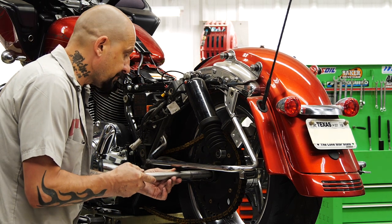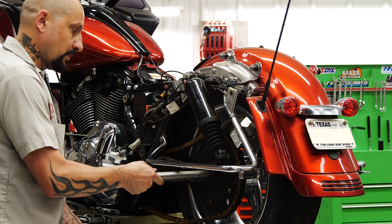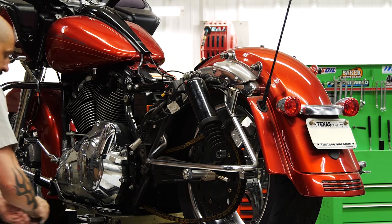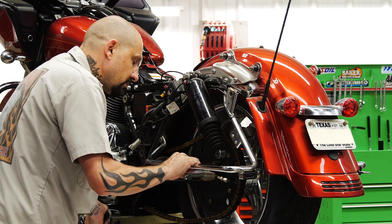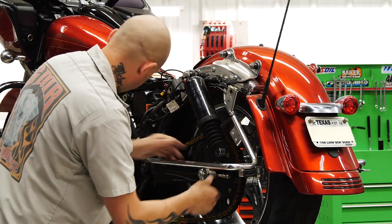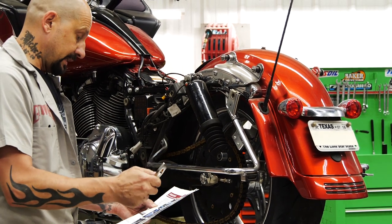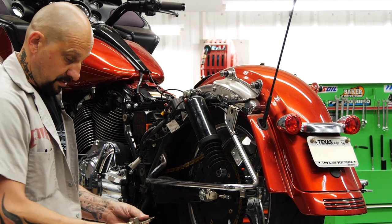Slide this in. At this point the adjuster wanted to hit, so hold it into position here first so you don't have to fight with it. Sometimes you've got to tweak the height just a little bit to get your axle to go through the other side. We're clear through. Take the other plate with the washer and tighten it up — just a small amount of tension; you're not torquing it at this point yet. All we're doing is getting ready to do the transfer marking and use the drill.